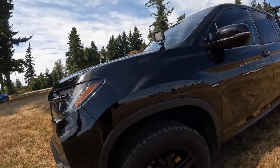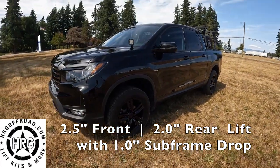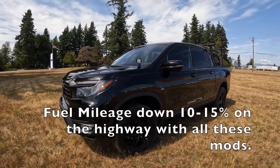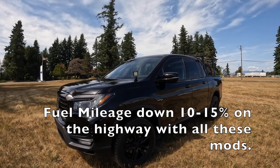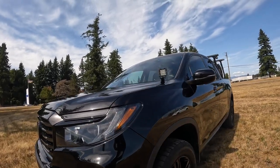You can't really see it in here but take my word for it — there's an HRG two-and-a-half-inch lift in the front and two-inch lift in the back, which also includes a one-inch subframe drop. That's just to help keep the geometry as close to stock as possible. It handles like stock. With the bigger tires and lift it'll still out-handle any other truck on the road. It's a great riding vehicle — handles great, I have no complaints.